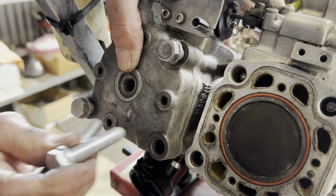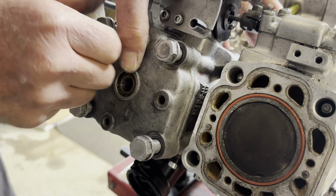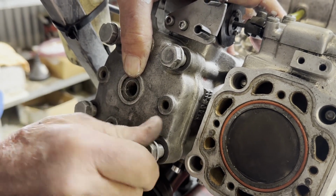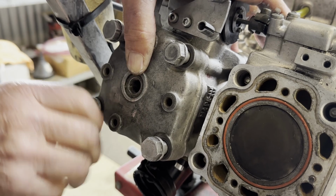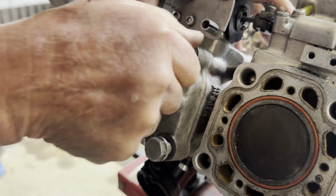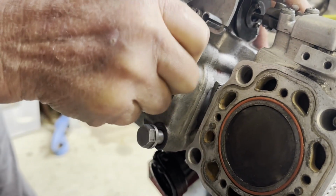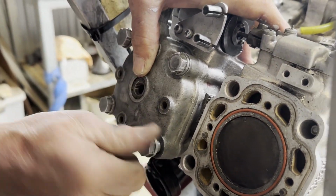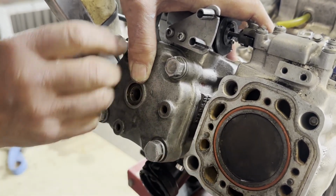With these head bolts, they're obviously as old as the bike. Yeah, they're aluminium head bolts that are nice and light, but also that means they're going to stretch and wear a little bit. So we're a little bit careful with those as to the tension we do them. Yeah. And then they're replaced at various times.